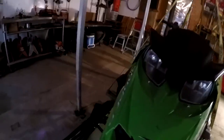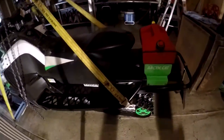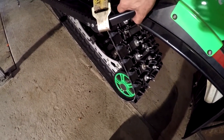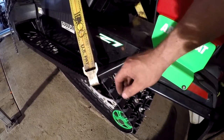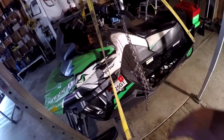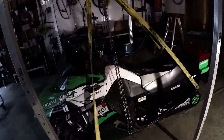I just had to make sure it clears the body. This thing's ready to be lifted. The reason for the hook at the back — it's not really pulling on it, but for balance it would droop down too much, so I just hooked to the body there. There'll be a little bit of tension but nothing that's going to tear it off, because it's basically just balanced. Most of the weight is on this bar here since the motor is heavy — everything's pretty much up front so it's almost directly under it. I'm about ready to lift this.